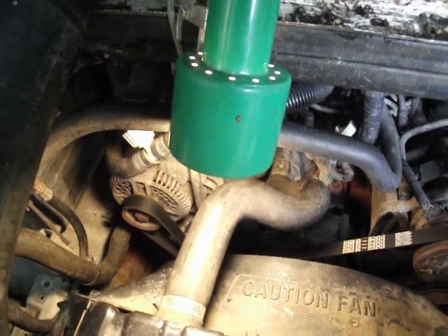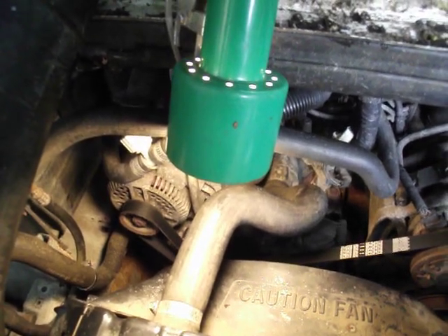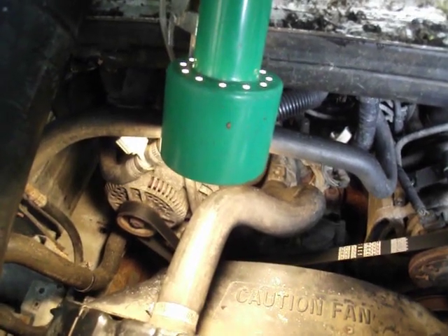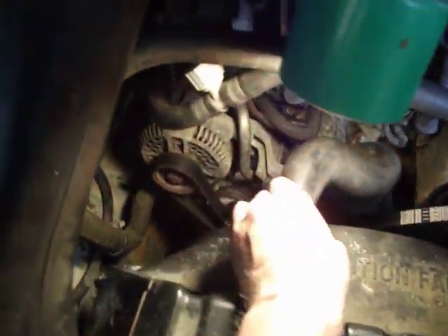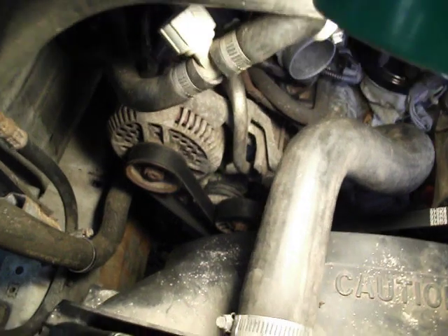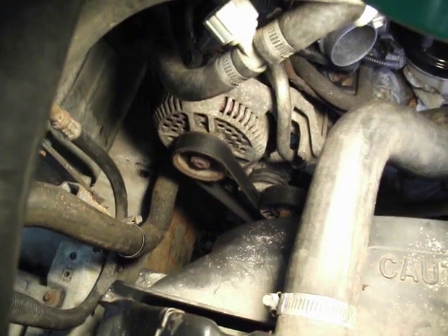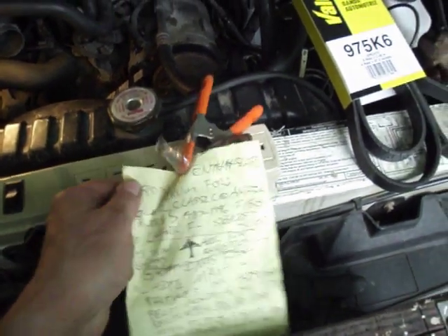The problem is that once the air smog pump is bypassed, the tension roller has almost zero effect on it. So what needs to happen is the belt needs to be rerouted. With the belt rerouting, the top pulley is not needed — you can see where I took that out on top. Here's how the belt goes now. There is a diagram on this information.